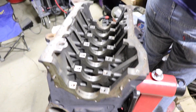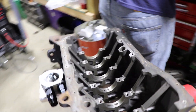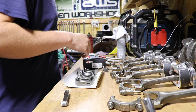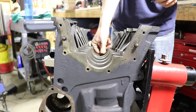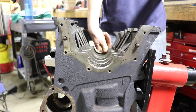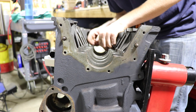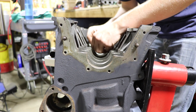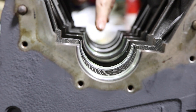We got all the rings on all the pistons and we're opening up the rod bearings and main bearings for the crank. We're about to drop it in and check the clearances and get this thing put together. These are the King Racing bearings — we got the King 1000s which are oversized. You've seen people say to use R36 bearings, the 3.6 bearings, because they're coated and cheap. People say they've never had problems with them either.